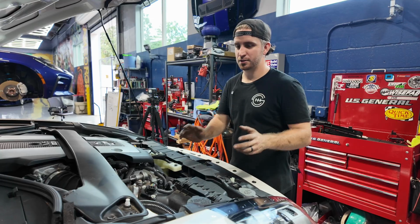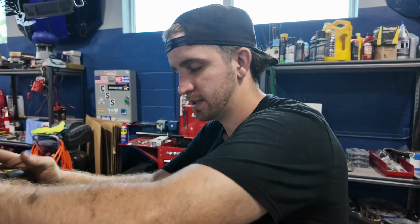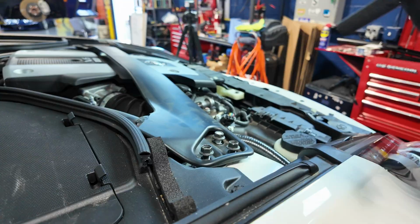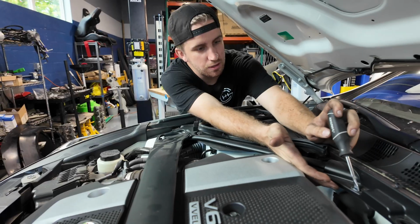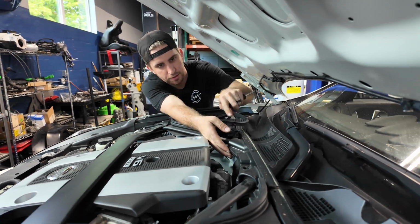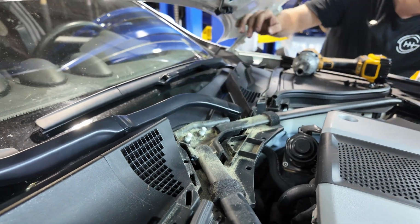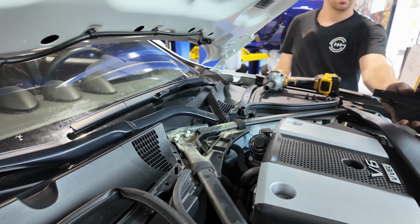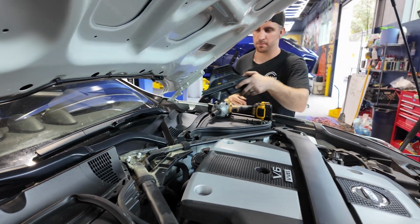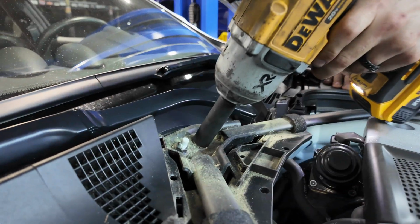You have to take off the crossbar in order to get to the bolts. It's just the 14s. Two clips, one right here, one right there, and then your rubber guard that goes across. Give it a little pop. There you go. Now you've got it out. It's just all clips. Just shimmy it on both sides. And then take your last 2 14s off.